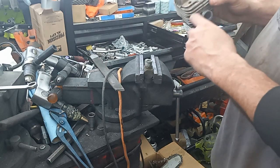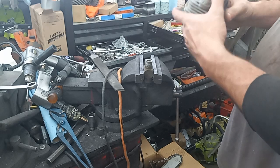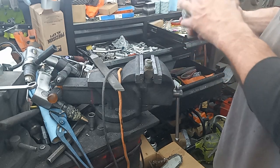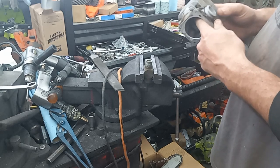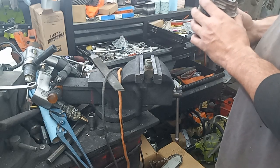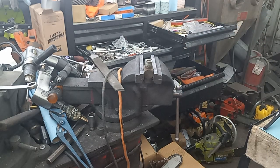Another option I was going to do — because I thought about welding up the combustion chamber — was to just come in here and weld a bunch of material in, then weld up the combustion chamber, redrill, tap, and do all that. But it's got a fairly small combustion chamber as it is, so I don't think I want to do that.